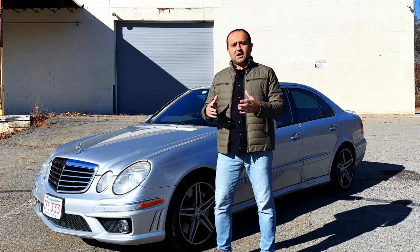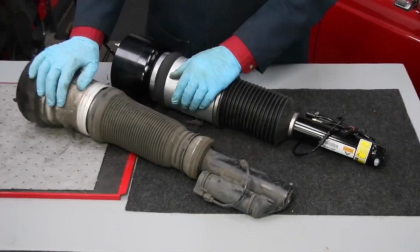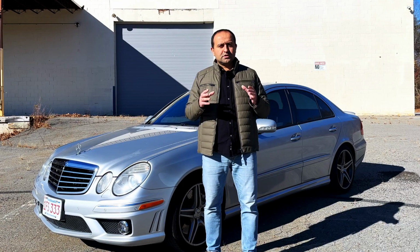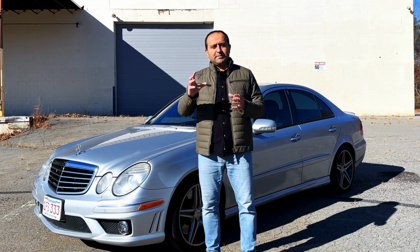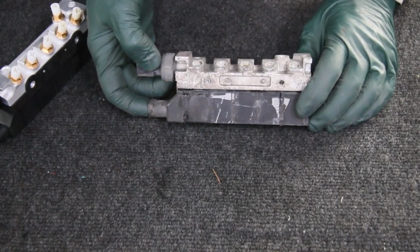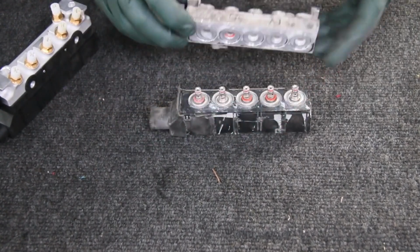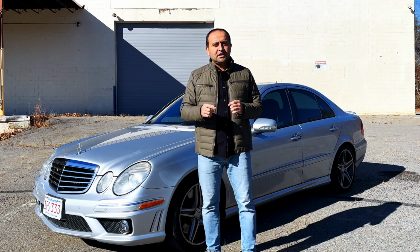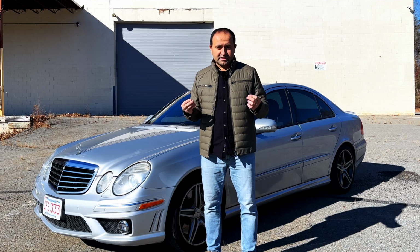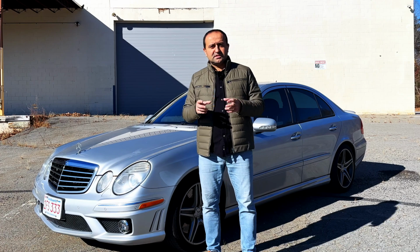What is this setup about? What are the major components of air suspension, or Airmatic? So you have air springs, like I said, or the air shocks and springs combined in one unit on all four corners or on two corners. You have the Airmatic compressor, that's an air compressor that pumps air into the system. You have a control valve that opens and closes each valve to inflate or deflate each side. And you have an Airmatic filter. And you also have air lines running to each of the air springs. I'm simplifying it. Obviously, there are a bunch of sensors: the speed sensor, other sensors, relay, etc.